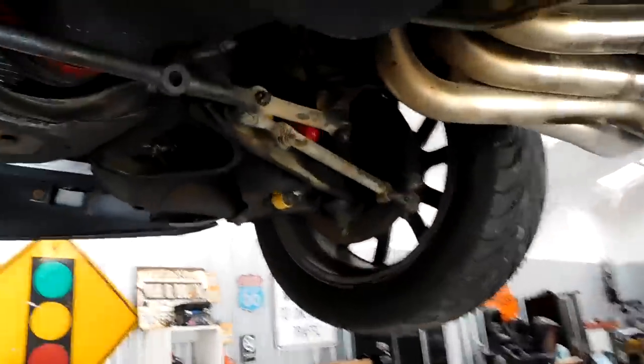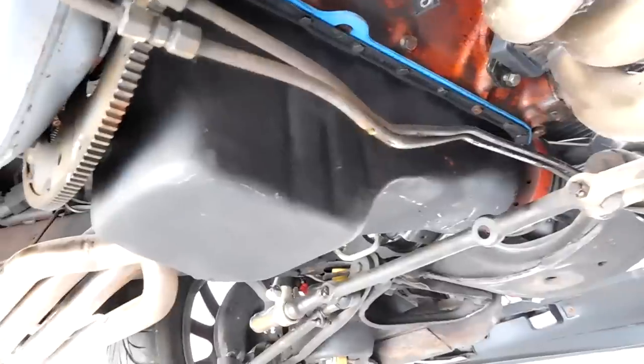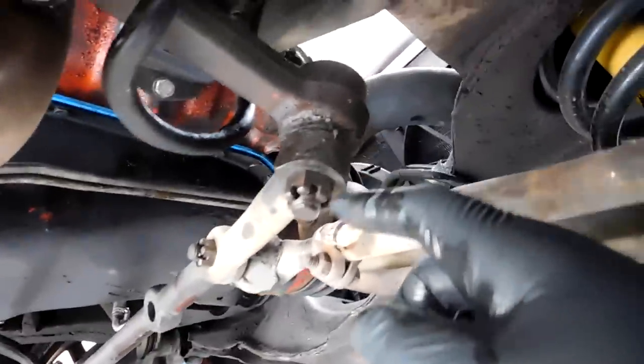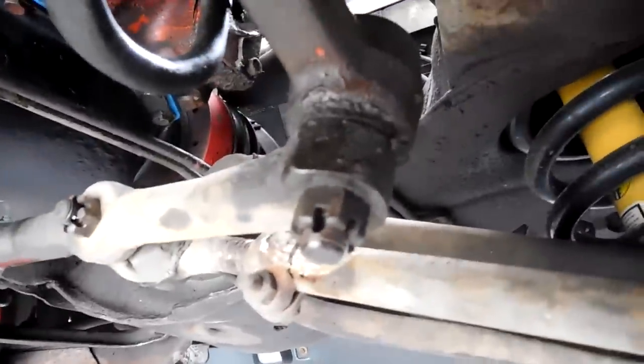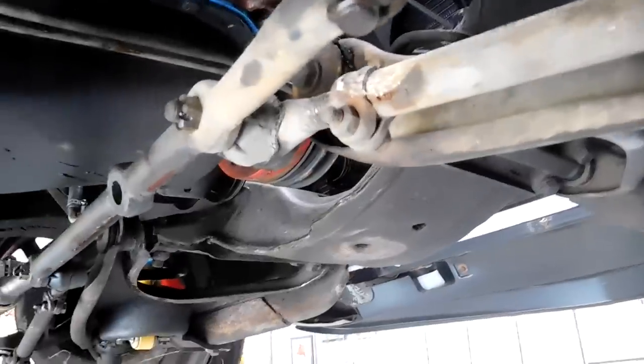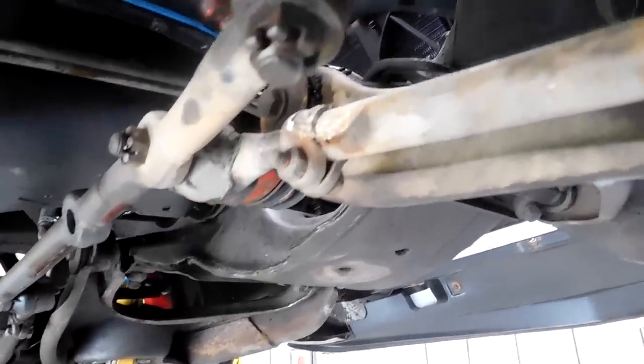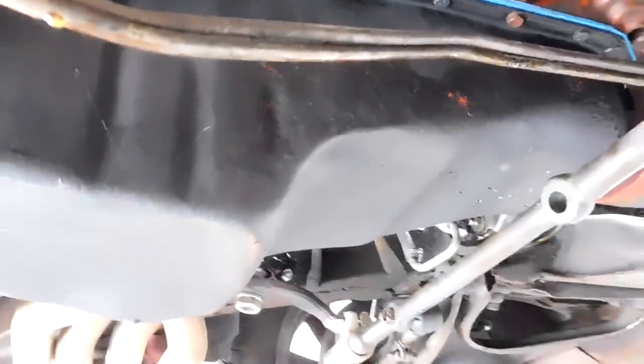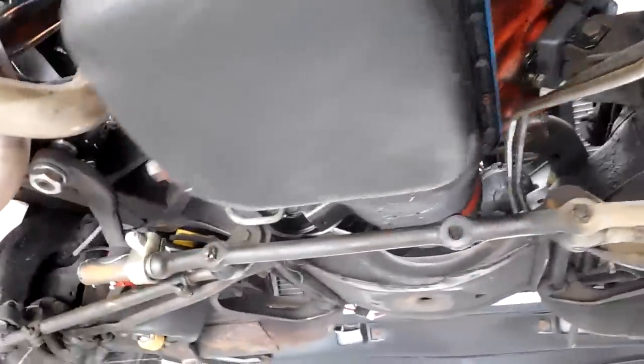Just for viewing pleasure, I want to take this oil pan off to look at the bottom end. Usually to take the pan off you have to drop the suspension — or excuse me, the steering from the idler arm — and if you notice, there's no cotter pin in there at all, so that's not good. But anyway, we'll get that dropped, we'll get the pan dropped, and we'll check underneath and see if we can find a rod or a main bearing that looks a little different than the rest.